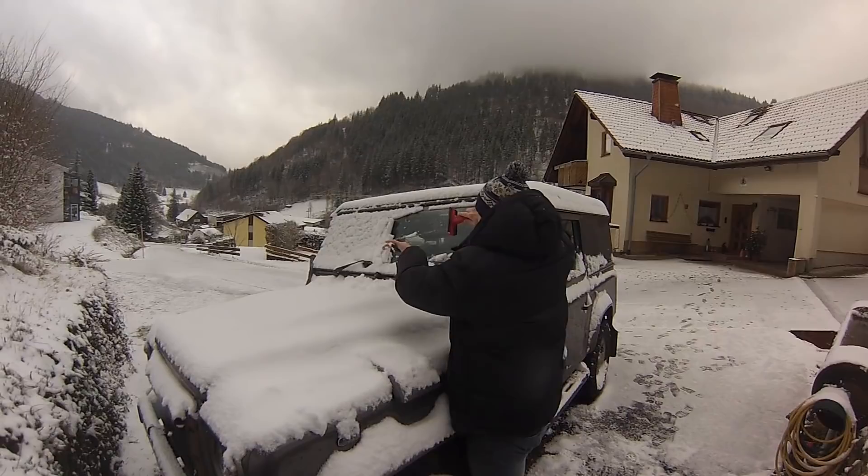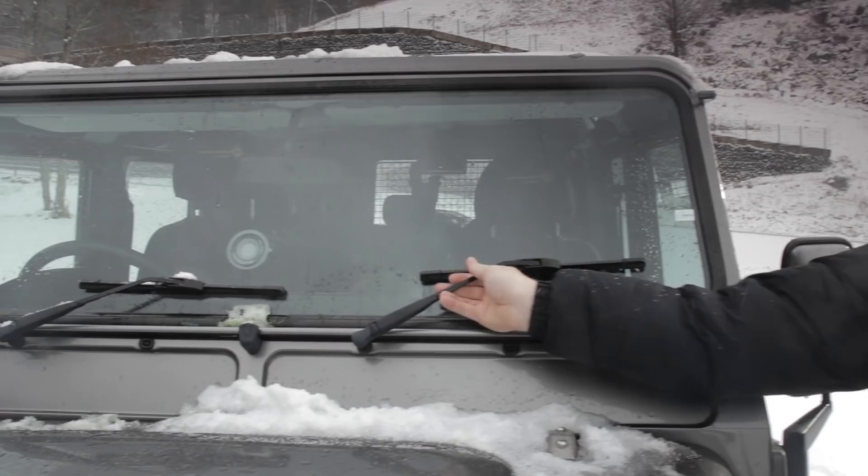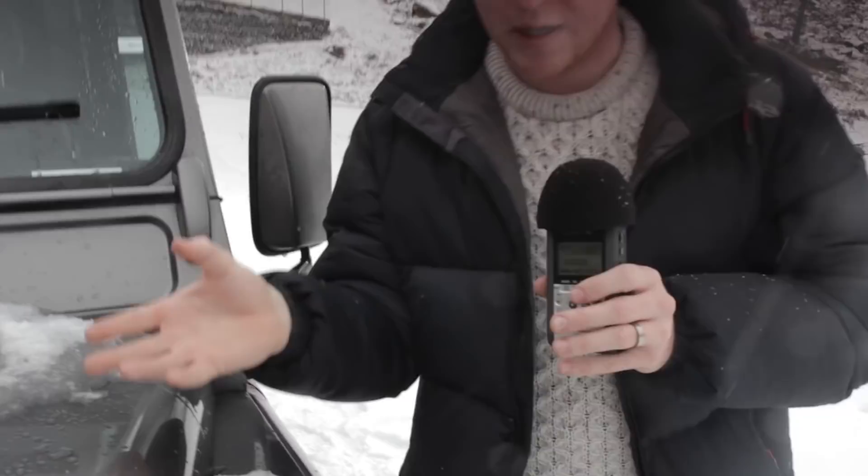We've lifted off the wipers before using them. If the wipers stick to the screen and you try and activate them, it blows the fuses. The fuse is actually the one that also manages the speedometer or your dials, which blows those out. So that's dangerous.